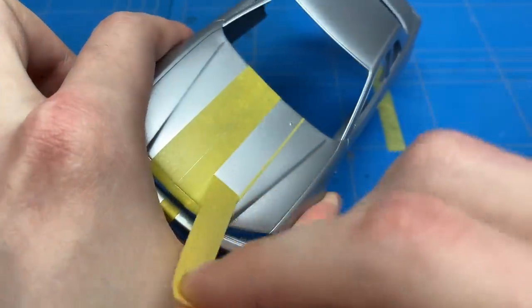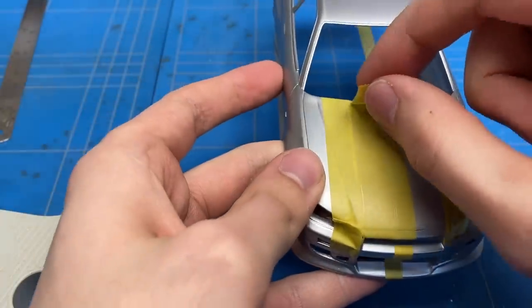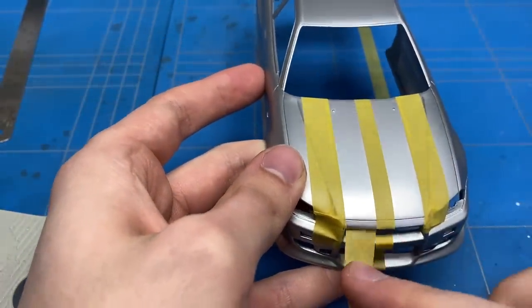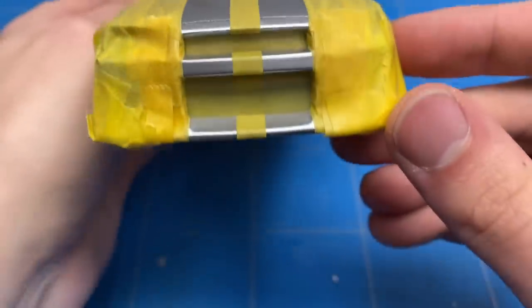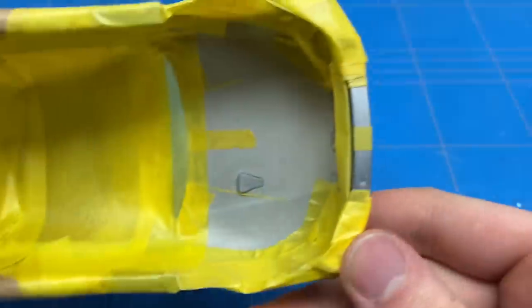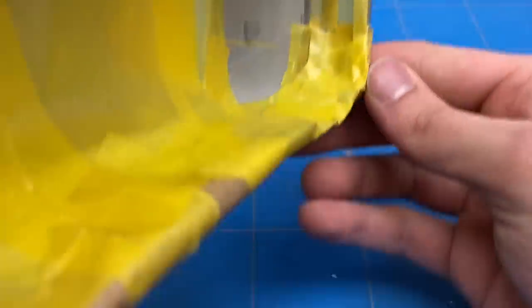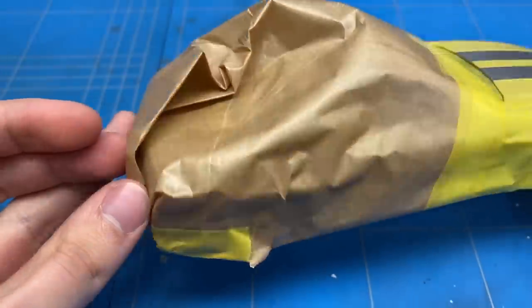After putting the fine line tape alongside that bigger piece of tape in the middle, the stripes were laid out so that middle piece could be removed to reveal the areas that of course are going to be painted blue. The rest of the body was then carefully masked off in the same manner on those lower sections of the bumper, and of course a lot of excessive masking has been done to the main body itself in order to not have overspray on that whatsoever.